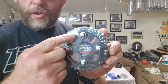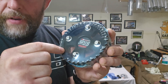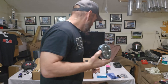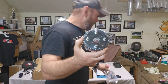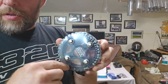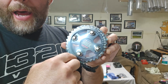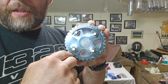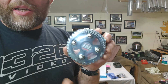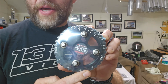This is the gear. What you've got — you can see the little magnets stuck in there — is 12 evenly spaced magnets facing in one direction and one facing the opposite. You've got a dual-pole sensor, and as your engine turns over it goes across the magnet. These sensors have LEDs built into them so you can make sure you're getting all the signals. As it passes, the little LED lights up; every time it lights up the computer sees signal and knows your engine position. It's got trigger as well as home. I've never seen a magnet fail in one of these — I've seen them covered in little pieces of metal and still function perfectly.